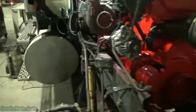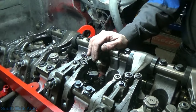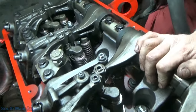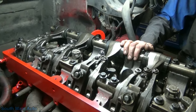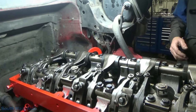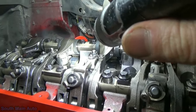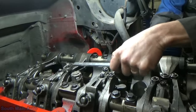That should essentially put us on cylinder five. I always check — everything's got play, injector is at the bottom, and I always look at the spring to make sure everything is where it should be. Always a chance someone put a harmonic balancer on that doesn't belong on the truck, so your marks could be off. The injector back there — it's the center — it's not completely at the apex of the cam but it must be to where they want it.